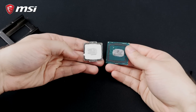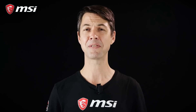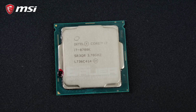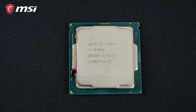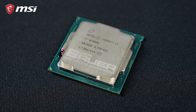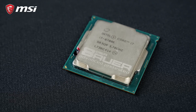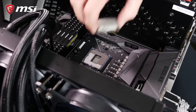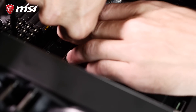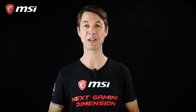The other, much safer way is to get a pre-delidded CPU. We got our hands on a Core i7-8700K Coffee Lake processor. This processor comes pre-delidded and already glued back together, so you don't need to do anything. Prepared by professionals, these CaseKing pre-delidded CPUs are guaranteed and come with a two-year warranty. The paste is replaced with liquid metal, which offers an even higher degree of thermal conductivity and is thus more effective at cooling the processor. This is by far the best and safest option out there.